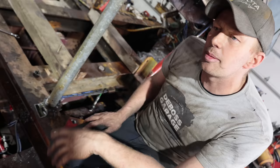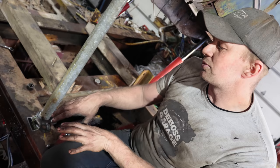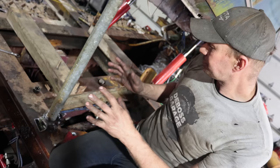ATF, I looked up, the viscosity was like 28 and hydraulic oil was 32. So I figured the lower viscosity should move freer. It's still pretty stiff, but in ideal situations, we won't be shifting that often. I'd still wanted all my gears though.